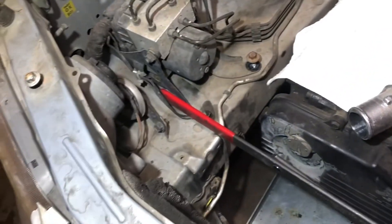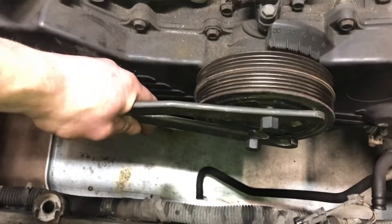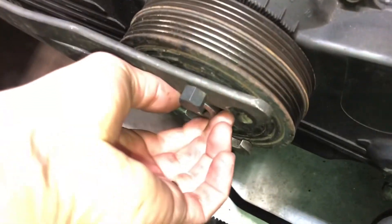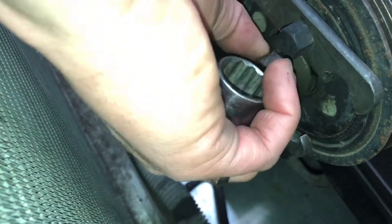I was able to use this tool - it's for a flywheel - getting the cooling fans off the old style where they were spun up to the front with the water pump pulley. I got the thickest pegs I could find for it. As you can see in there, luckily this crank had holes. I've already loosened it with a big breaker bar and it was well tight, so I'll have to make sure I do the same going back together. Sometimes they have ridiculous torque settings for this stuff, like the newer Chevys. Alright, got the crank bolt out.